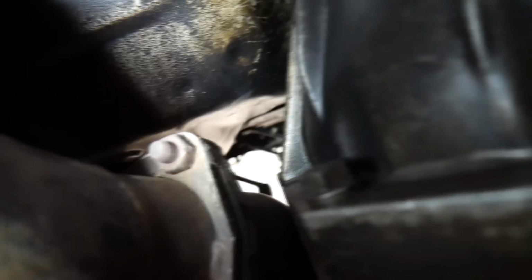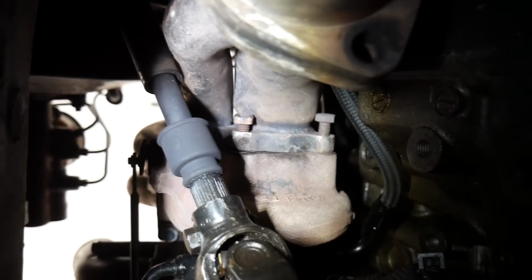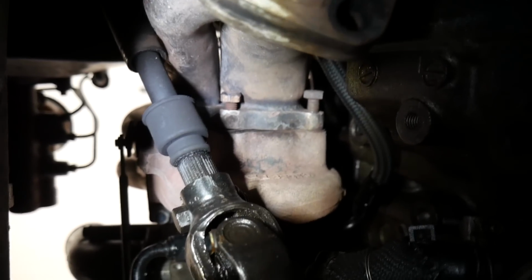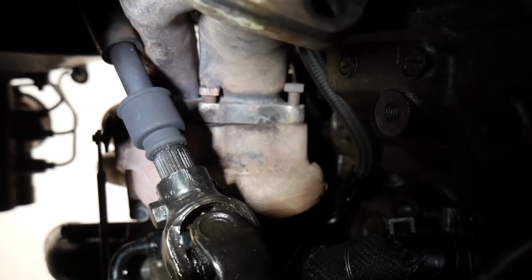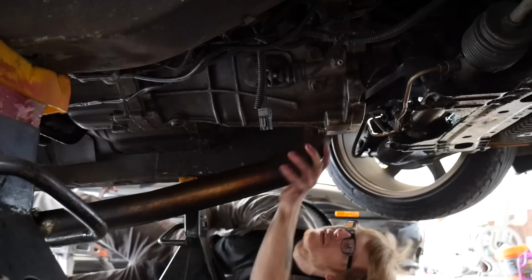But basically, missing a bolt here. Now, take note, I haven't touched anything down here yet. Missing a bolt here, and that bolt is backed almost all the way out. And this one over here is actually a stud with a nut instead of a bolt, so it's actually been swapped and touched. And if you look up there at the back of the turbo, these bottom two are completely backed out as well, and there's one missing up there and one tight. So out of the 5 bolts at the back of the turbo, 4 of them are basically useless.